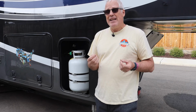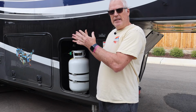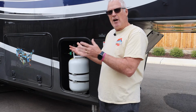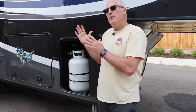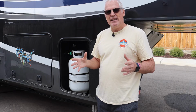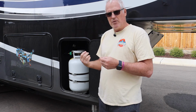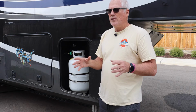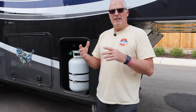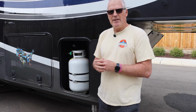Go ahead and press our controller or our switch, whatever we happen to have, open up the other slide. Now this takes care of the problem that Dina and I have. I can leave the slide on the sewer side, the off door side, we can leave that closed, open up this side, and that's way Dina can get inside and work or get what she needs to get done. I can get the sewer hoses all hooked up and everything else. Once I'm all done, all I have to do is change the knobs again and hit the button, and we can open up the other side. Let me show you how we're going to do that.